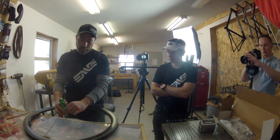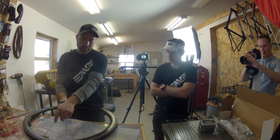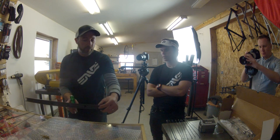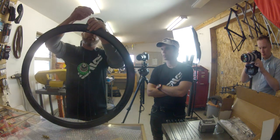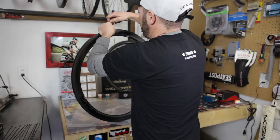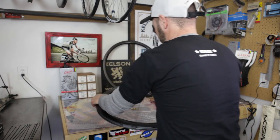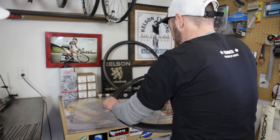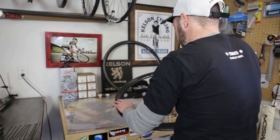So we've got innies and outies, two on each side, right? Does that make sense? So now we're going to skip a hole. Four holes, three holes, because you've got to have the other side. And you said three, right? So we're going to have two on one side. How many holes is this rim? 24. Yep, so we're going to have 12 on each side. Six outies on one side.